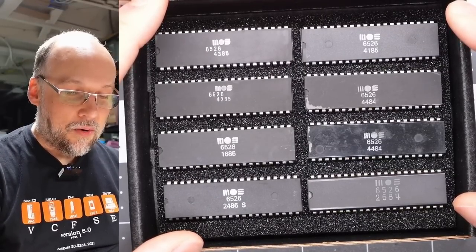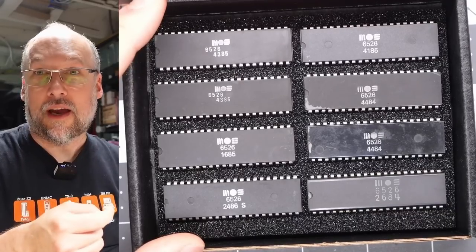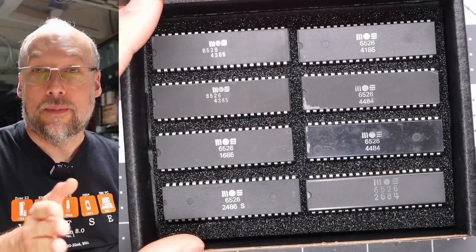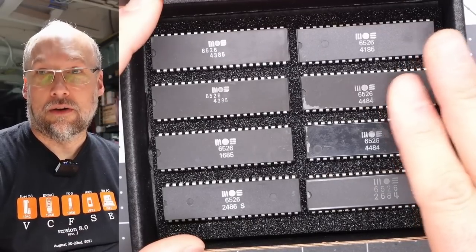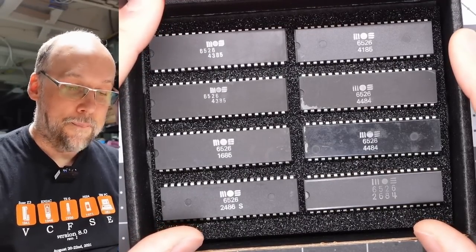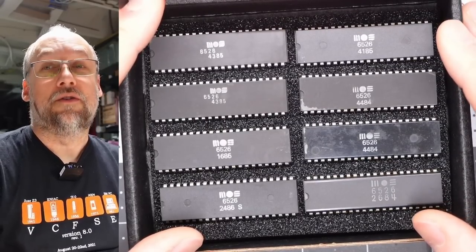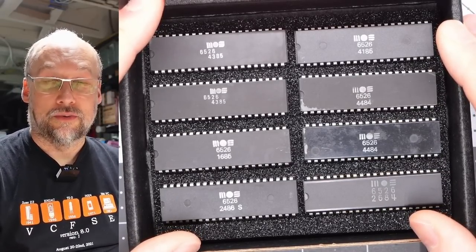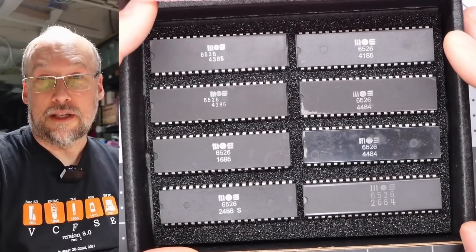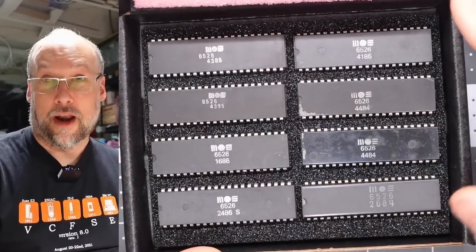Right now, it is the one chip where there isn't a good aftermarket replacement, although people are working on it. There are some FPGA-based replacements underway, so they're just around the corner. The question is whether it'll be cost-effective to replace the chips in your machine, or whether it'll be cheaper to buy replacements off eBay. When I do those C64 repairs, I put a working 6526 in there, but I don't leave that chip — I took it out of another working machine, get it working in the machine under test, then move that chip back to its original machine because even I don't have very many of these.